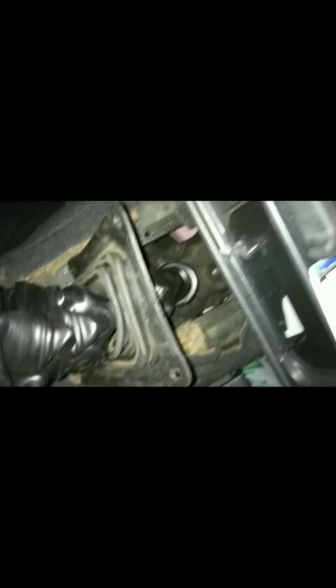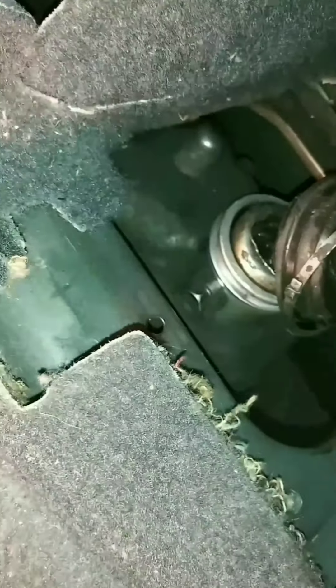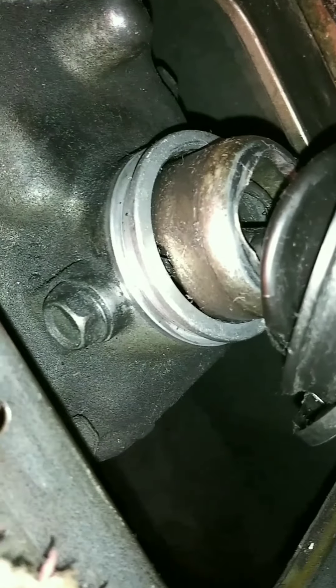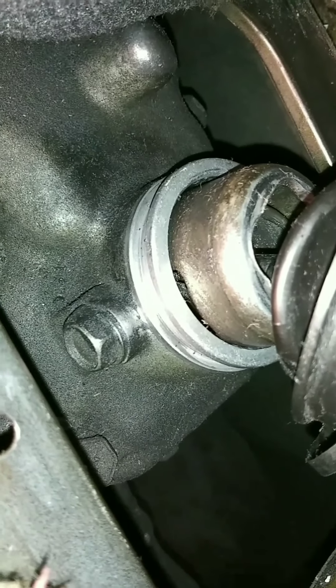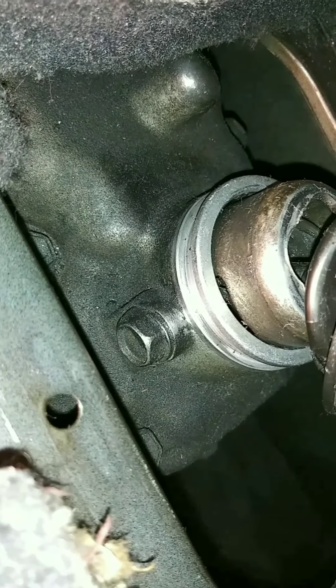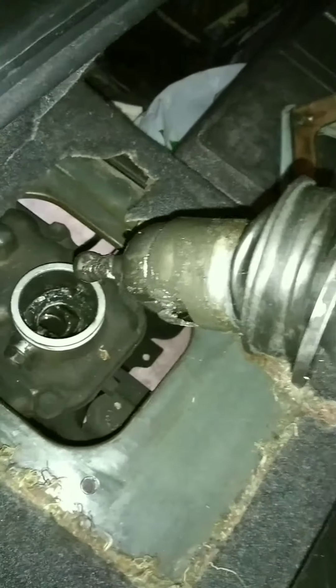This is the inner boot — pull the inner boot out of the way. The instructions say to push down and rotate counterclockwise on the gear shift control case cover. I pushed it down really hard, turned it counterclockwise, and it looks like maybe an eighth of a quarter turn and it popped out. So now the shift lever should come out. Shifter's removed.